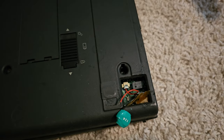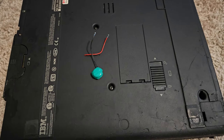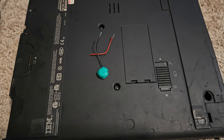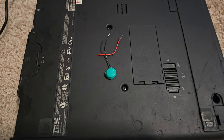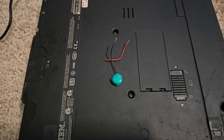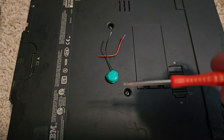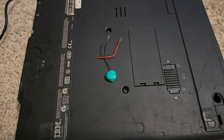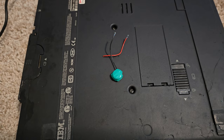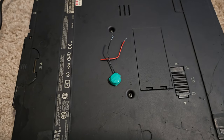I got the sleep-wake battery out, but unfortunately as I was taking it out the connector completely disintegrated — really, really old plastic. I worked very carefully with a tiny little screwdriver, gently pushing from both sides, and it just disintegrated. So I knew I was going to have to get a new battery, but I'll also have to solder something back together to get the battery to reconnect. Anyway, let's see if the computer works now.